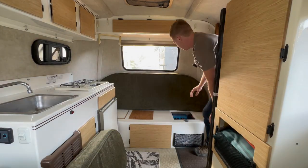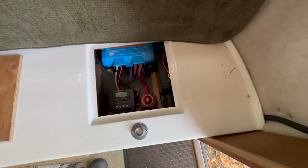The issue I realized — and I came across this on a long trip to Utah — was that I had put 200 amp hour lithium batteries in there, and each of those weighs around 30 pounds. Since this trailer is so light, 60 pounds in the back of the trailer behind the axle makes a big difference for trailer sway. I had some very scary moments on the highway. On my trip back from Utah I moved the batteries from underneath that bench to underneath this bench, just to see how it would affect the drive, and it made a huge difference.